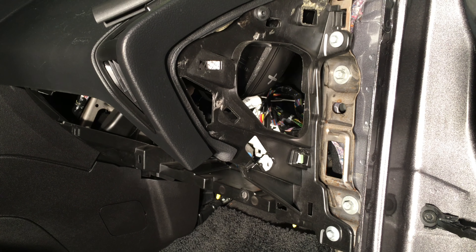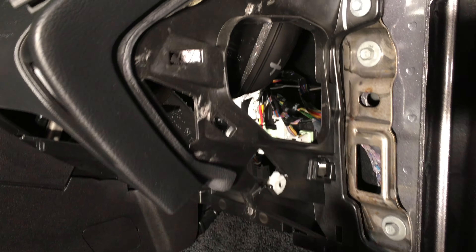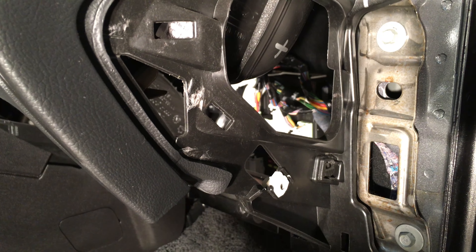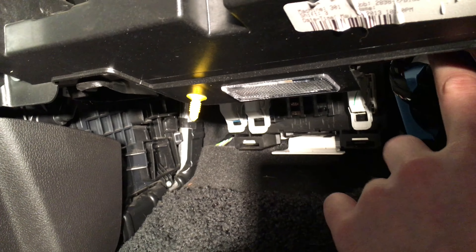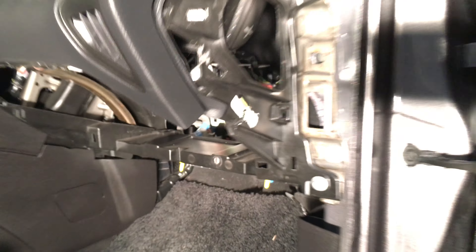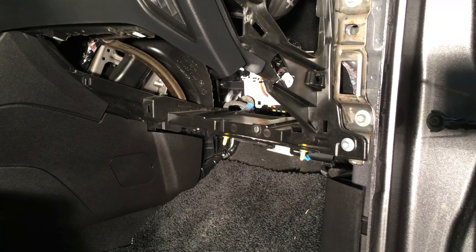You will need to take the end cap off — there's a screw that goes right here where the glove box goes in, and the back side of it lines up with this. There's a screw there, and there's two screws in the back here. I do apologize for the light. Then there's two screws right where those white clips are, so there's a total of five screws to get your glove box out. That will get you access into a boot that you'll be able to run your hot wire through — it's an actual rubber boot, so that's really what you want to do.